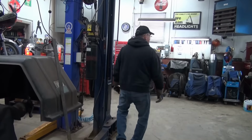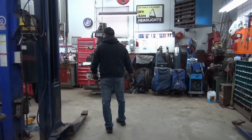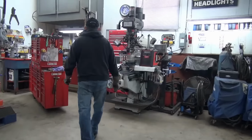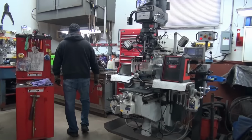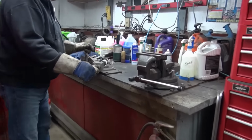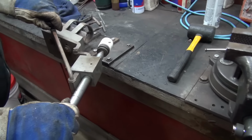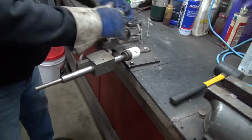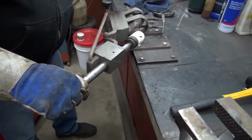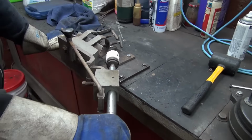And then we will show the viewer something that they haven't seen here before. A tubing notcher. You probably don't even remember this. It's kind of dirty and dusty now. You put your tube in there, put your drill on the end and get the angles that you want. This is all movable and adjustable. This can move up and down or whatever way. That's the one you made, isn't it? Yep, a long time ago now.